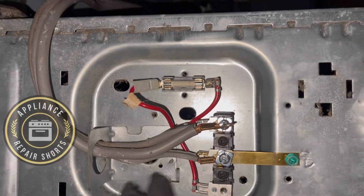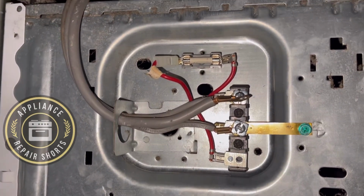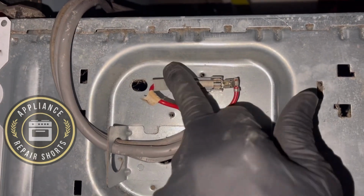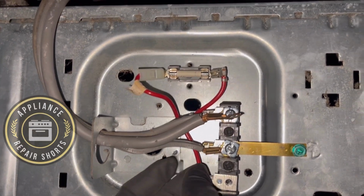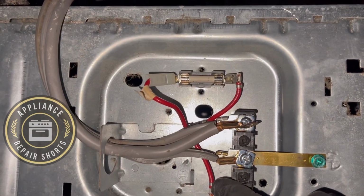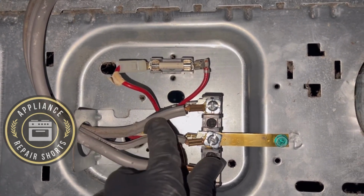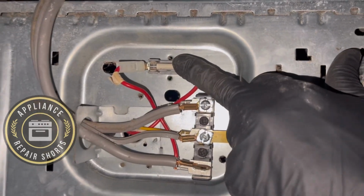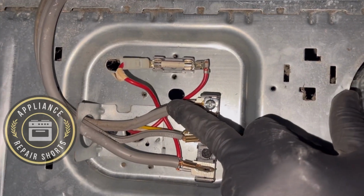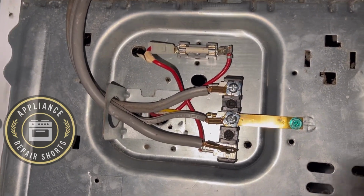fed. And last but not least, let's say for example, it's late and you fixed the issue in the door or wherever the short was that caused this fuse to blow. You can take this out of circuit. You disconnect this wire, and this one going here, you'd put it here, and then reconnect this, and everything should work just as fine. Many GEs now don't have that fuse, but since it's there, it's a safety thing. Fix the short, because if you don't fix the short, you're not going to solve anything. You're going to be destroying the wires, eventually tripping the breaker, maybe even causing a fire.